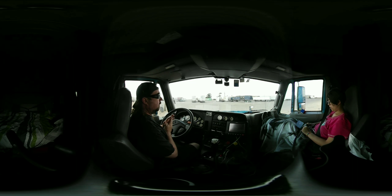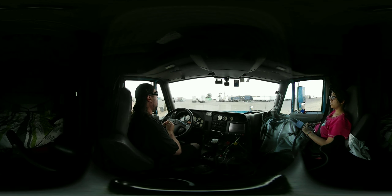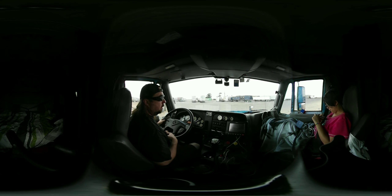In this section of the video, I just want to show you the proper way to leave a truck stop in the morning. After you've done your pre-trip and you're ready to go, you've already checked the fifth wheel, but we always want to do a tug test to check the fifth wheel.